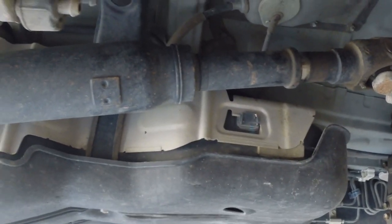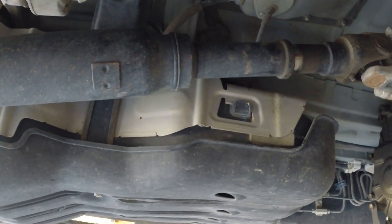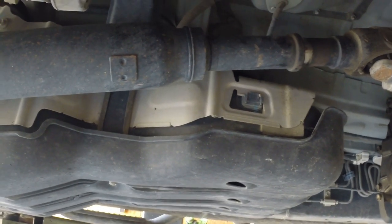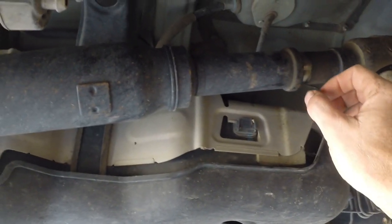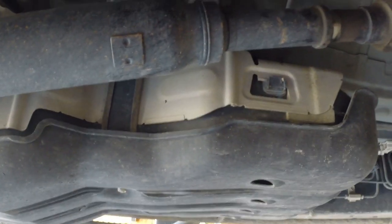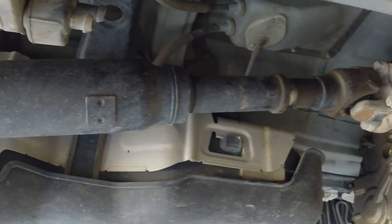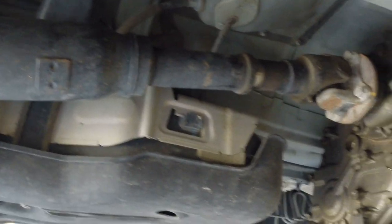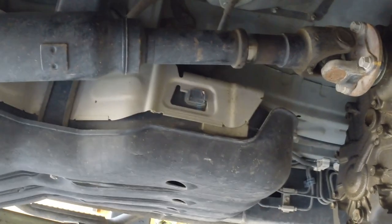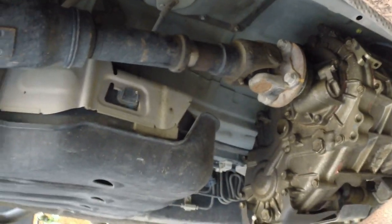This slip yoke has the normal 4Runner/GX 470/FJ thump — you pull up to a stop sign hard on the brakes, the vehicle rocks forward and stays still, and then when you let off the brakes there's a huge thump and customers feel like they got rear-ended. What's actually happening is with these all-wheel-drive trucks this guy expands, and when you get on the brakes there's enough force to keep it from going back in. When they let off the brakes, the driveline relaxes and this guy comes back in an instant, releasing all the energy. This grease zerk greases that guy and this one looks ready for some grease too.